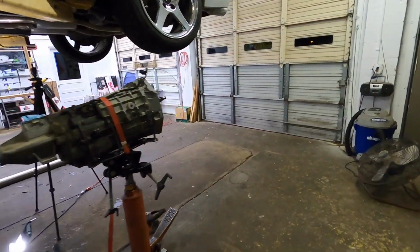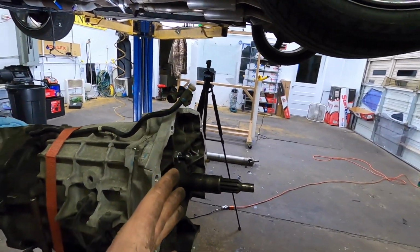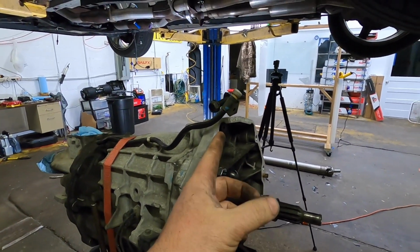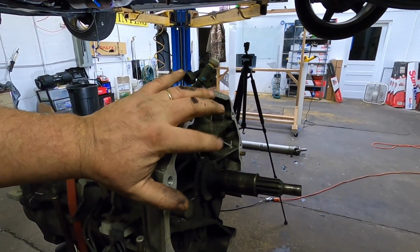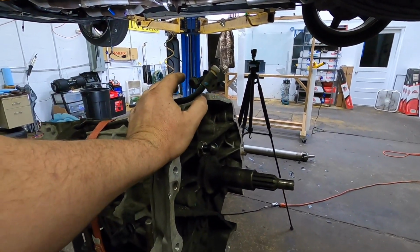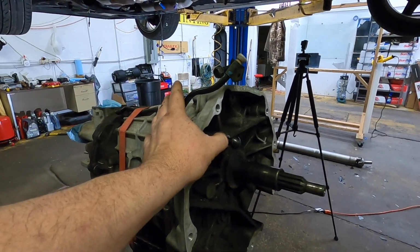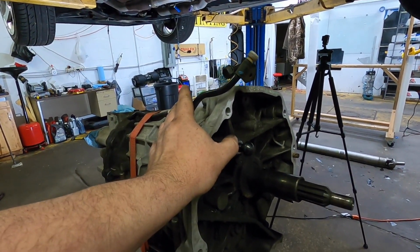One thing I want to go over real quick: if you're using a McLeod twin disc, it does stick out further than the stock pressure plate setup, of course. So what I recommend is using an adjustable pivot ball. Now, I've got this one set in a quarter of an inch further in than the factory pivot ball. And that's usually what works for an 03/04 Cobra with a twin disc McLeod setup, I've found in the past.